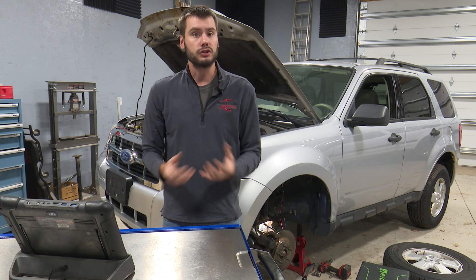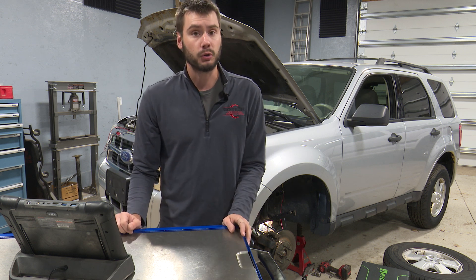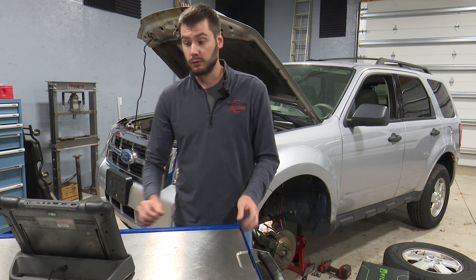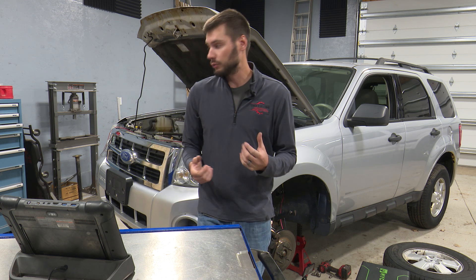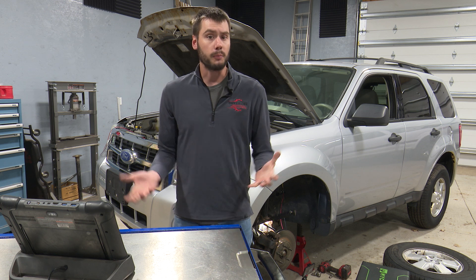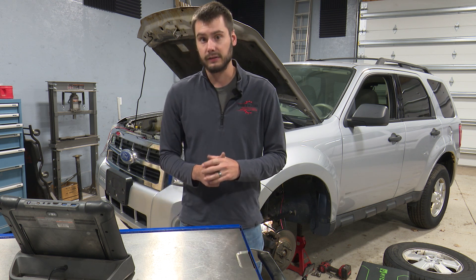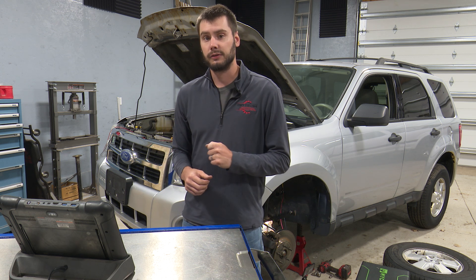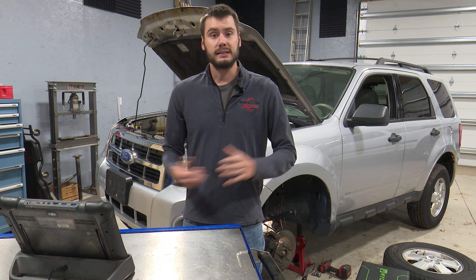Quick, simple, easy test that you should be able to perform relatively quickly — faster than swapping sensors, definitely faster than accidentally putting in a sensor and not fixing it, and probably faster than getting out your lab scope. You don't have to get a scope out; run some jumper wires, swap the signal over to the other side, and verify that it works. I hope you guys liked this quick tip. If you enjoyed the video, give us a thumbs up, subscribe to our channel, and click that bell icon so you get notified when we come out with new videos. Also check out our Facebook page — look for Gotek Automotive on Facebook. We'll see you next time. Happy wrenching, everyone. Thank you.